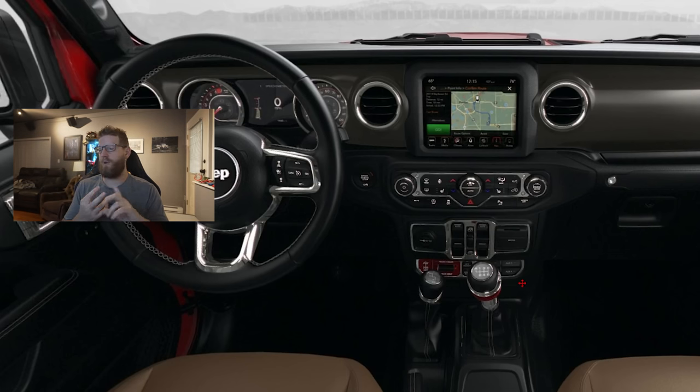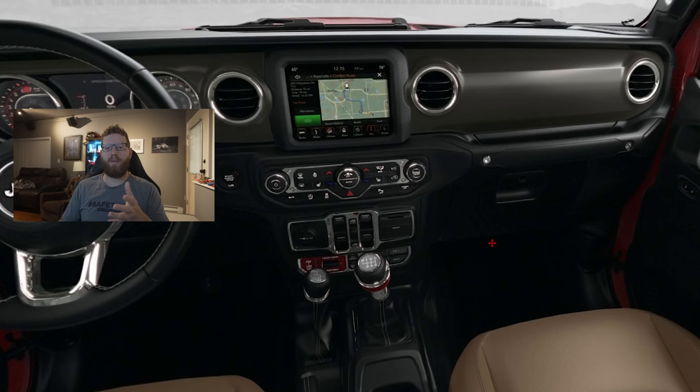What's really great is that you can change how these switches work — you can set them to automatically retain their state from the last time you used your Jeep, which is really handy for my radio. You can toggle it to be momentary press or toggle locked on or off. You can configure them through Uconnect on the dash. The other really cool part that a lot of people don't know is you get four auxiliary wires under your hood to wire up lights, but you also get the same four auxiliary wires underneath your dash. So if you wanted to wire something up into your interior, you've already got access to that power inside your Jeep.